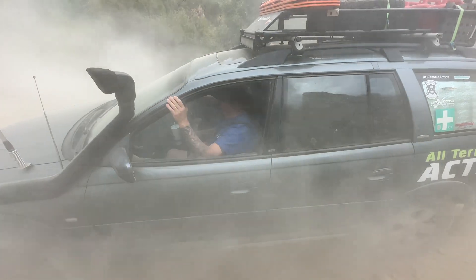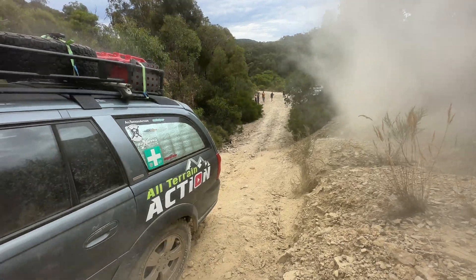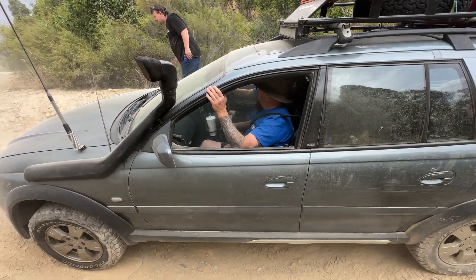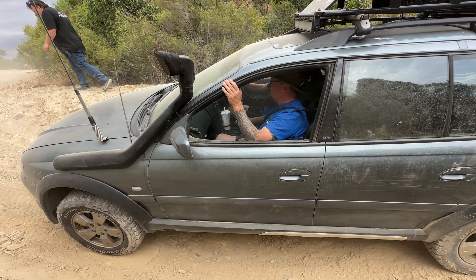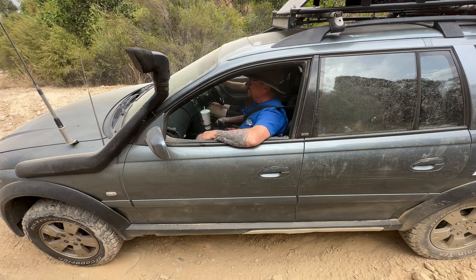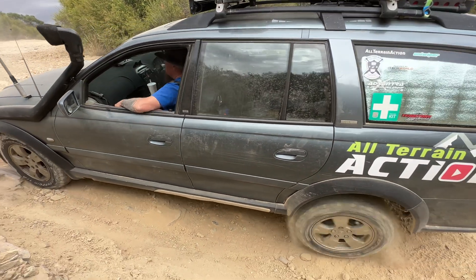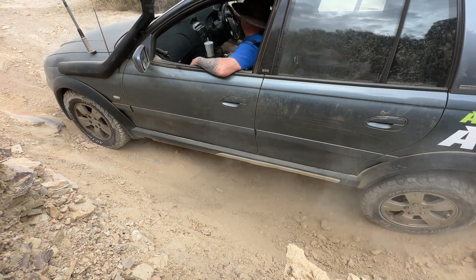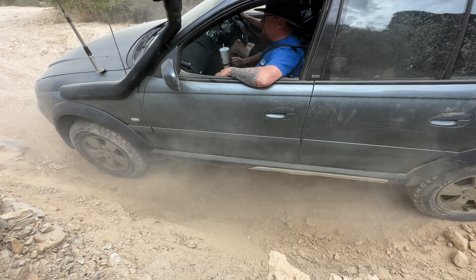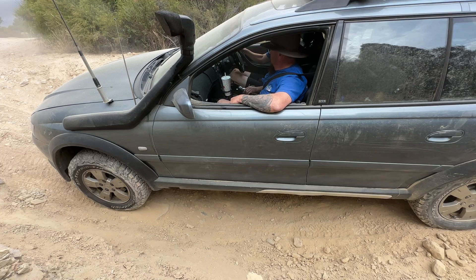You can see here when Will was driving my car, he had to find a good throttle position where he was able to drive power from the engine down the driveline to all the wheels, but also not enough power that would overcome the braking on the wheel that's up in the air. When he finally found that precise spot, he was able to drive the car with the wheels on the ground — the wheels that had traction — past this point, so the vehicle would make it over the hump.